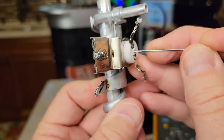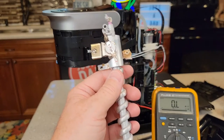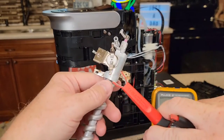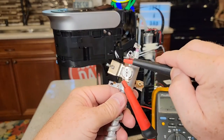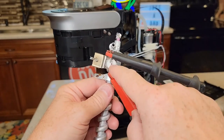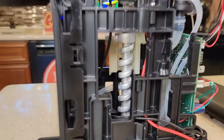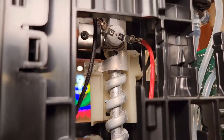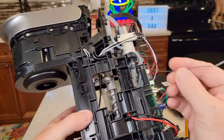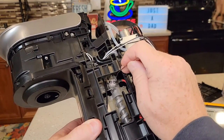You may hear it click just a little bit, but you've got to press it in there. If you want to check it before you reset it, take your continuity tester and put one probe in — you'll have it open. Then as soon as you reset it, you'll have continuity between here and here. If we look on this coffee maker, it is right there, kind of right there in the middle. Take your paper clip and you can go right there and reset that.